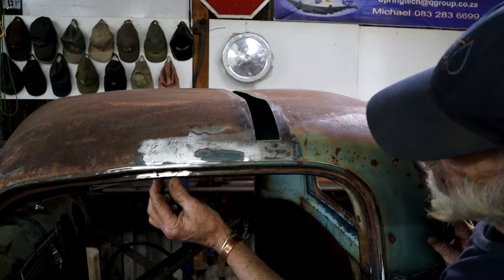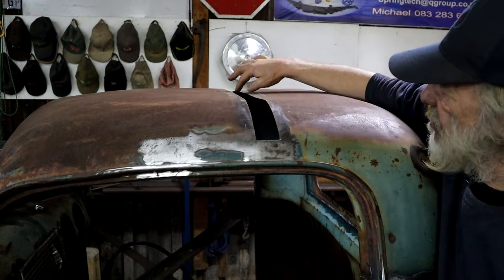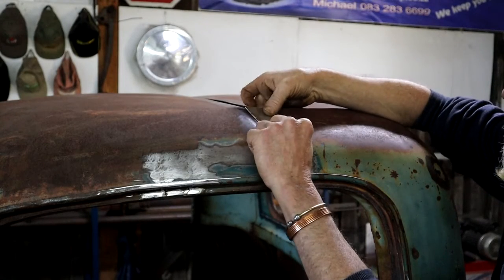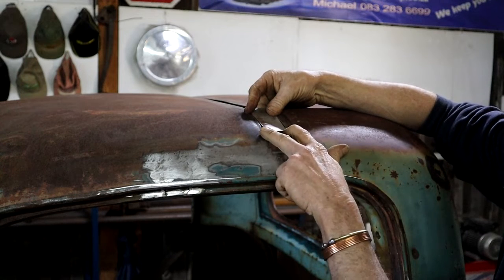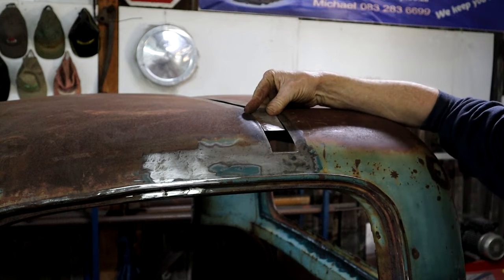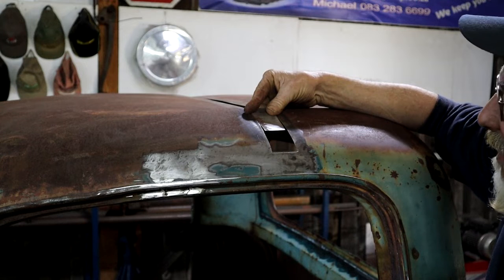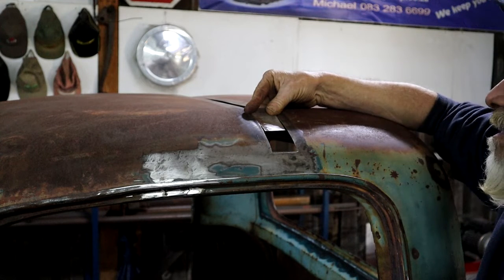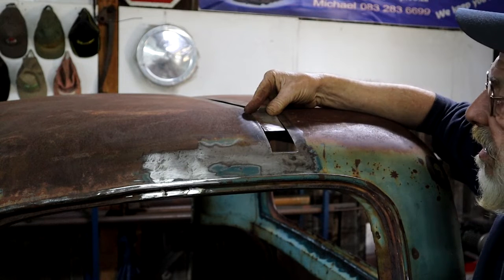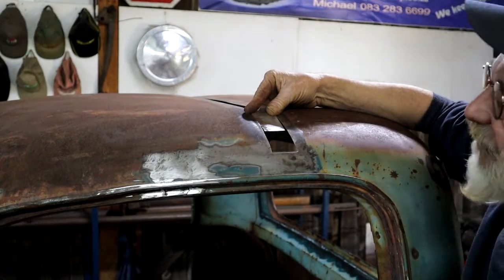So this little full piece is in place, but I've still got to deal with this gap that runs all the way across the roof. So if I was chasing a flawless paint job, one would obviously have to use a piece that fits in the gap that's going to be flush. We would have to spend a long time welding it up very slowly, grind it flush, then spend even more time with a hammer and a dolly, and probably even a planishing hammer to get everything nice and smooth — so that you can apply as little Bondo as possible to get that flawless finish.